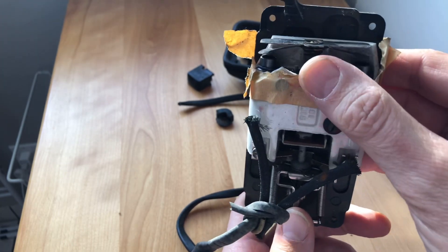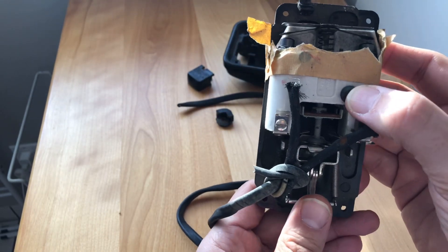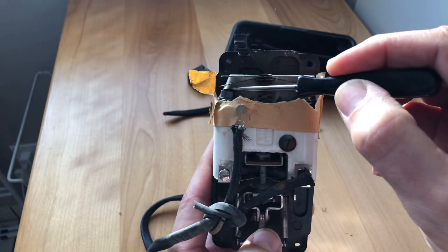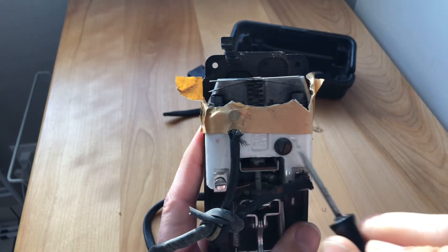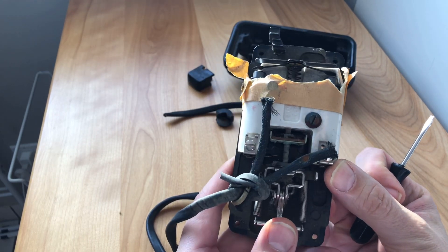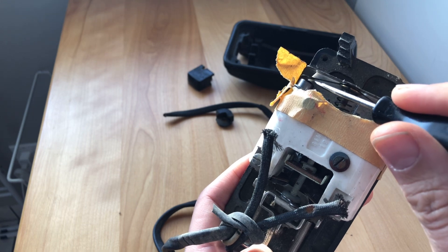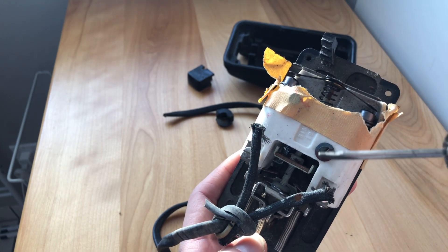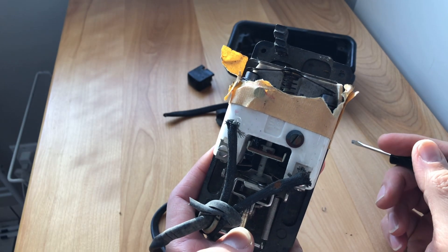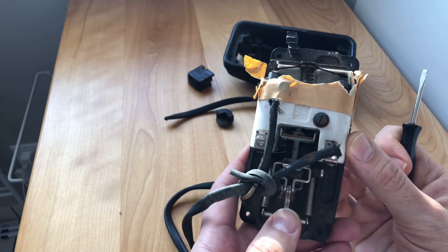While we're here, let me show you how this normally works. There's a big chunk of porcelain missing — it was broken and damaged at some point. When you put your foot down, it pulls this piece closer, and there are contact points right here. Underneath, down in this silo on either side, are carbon discs. As it gets closer — say you're pushing the pedal slowly — you get more electrical contact and those discs begin to get closer to each other, providing more power. If you floor it, all of the discs are fused and conducting electricity.